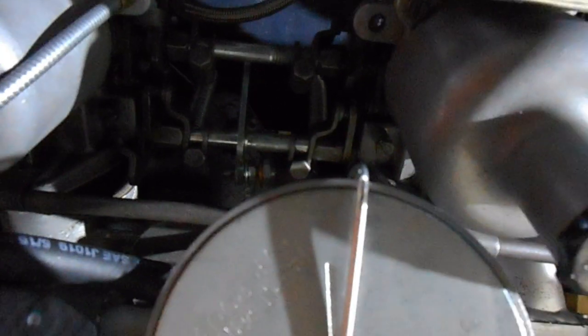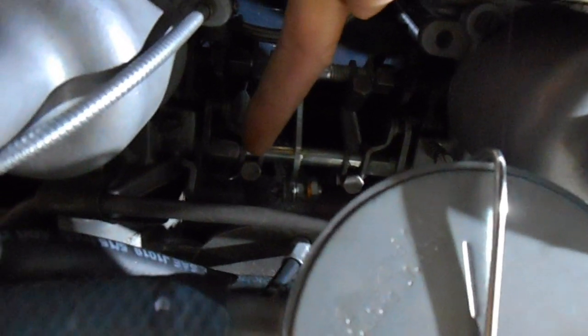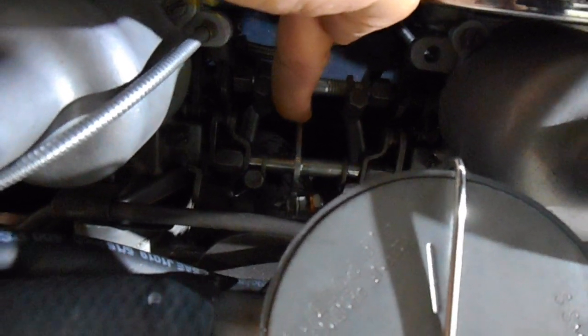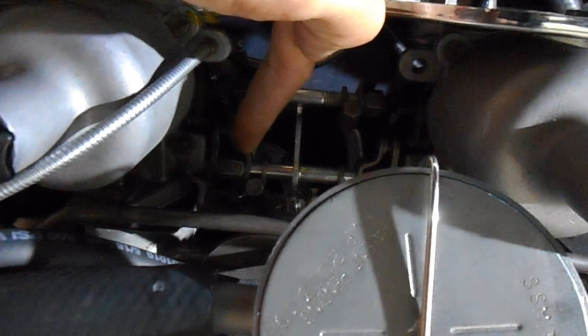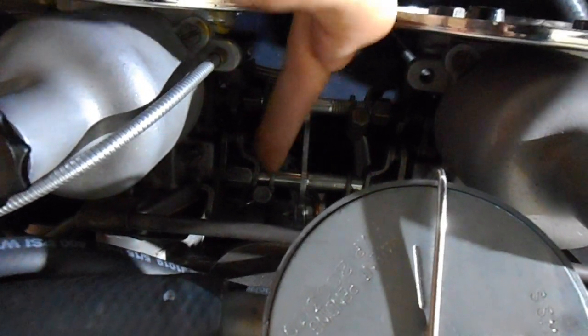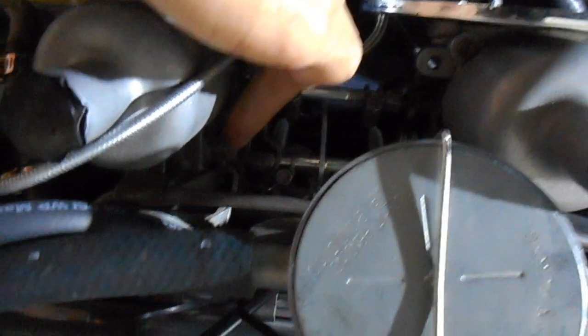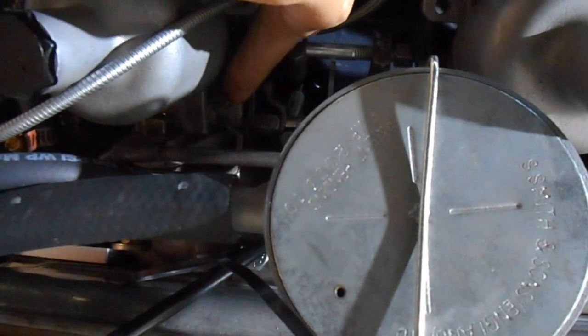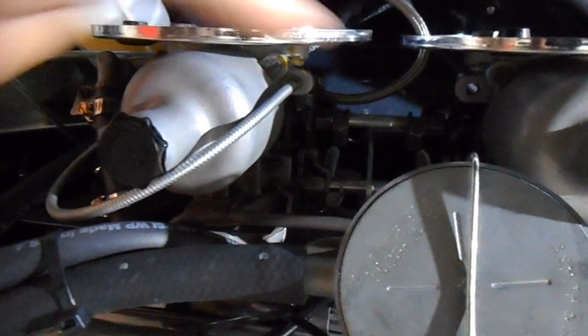Before I adjust that I'll just take you in a bit closer so you know what exactly I meant to do. This is a bit tricky — I can't see the screen, but you want to loosen this nut here so that when you press the accelerator it prevents this from moving, and the bar will run freely inside there. Then what I can actually do is tighten the idle adjustment screw until I get the same air pressure on both. So I need to loosen that first.